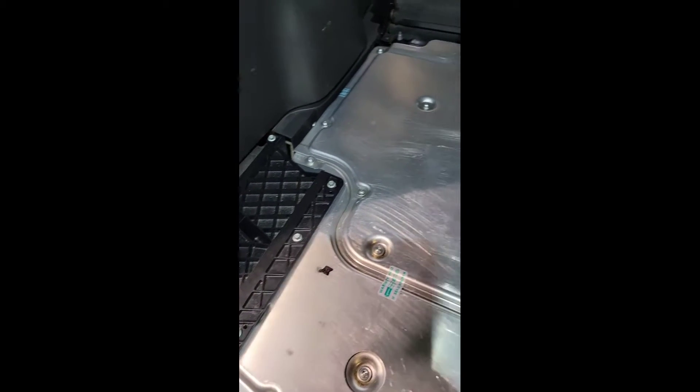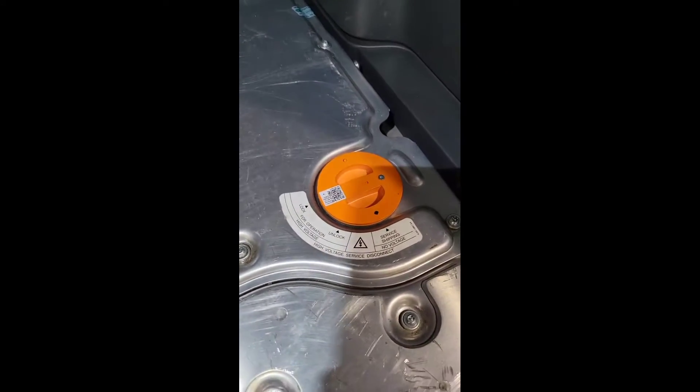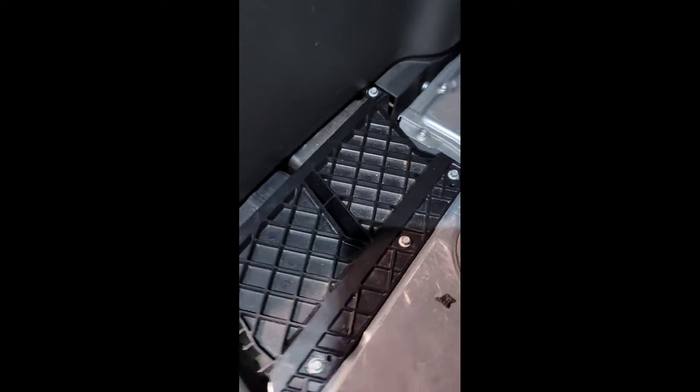To service these cooling fans, you have to take out the high voltage battery. We've already put this in service mode, which disconnects the high voltage battery. The first thing we've got to do is take out this ducting — you're going to have five screws. This one's missing the lower part. So we're going to take these out and remove this ducting.